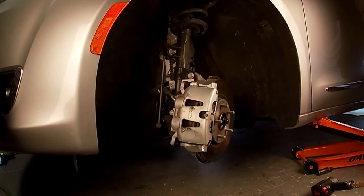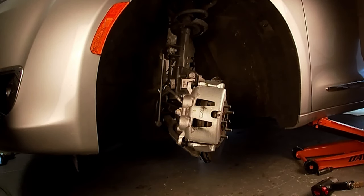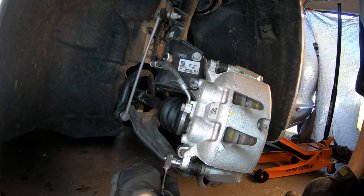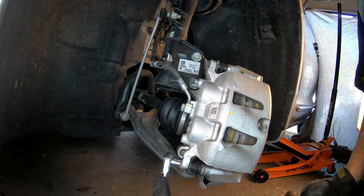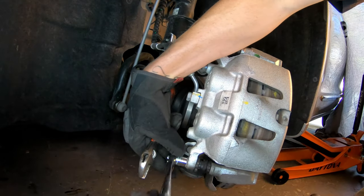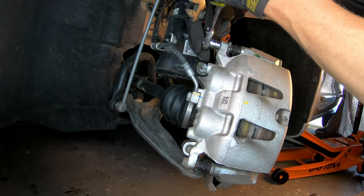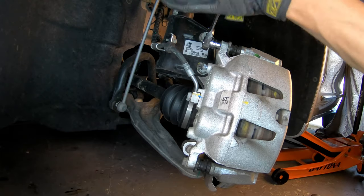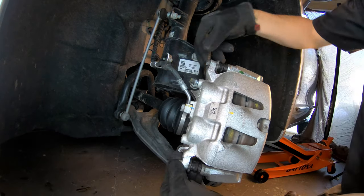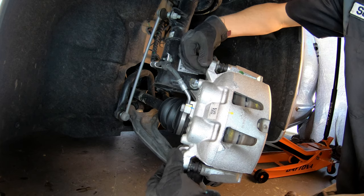You can see I am turning the steering wheel to the driver's side so it's a little bit easier to access the caliper to remove it. I usually notate the size of the sockets I'm using, but I didn't write down the caliper bracket bolt size — I'll correct it in the description. To get the caliper itself off of the bracket you're going to use a 13 millimeter, hopefully a six-point socket, to remove these two bolts.